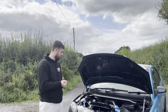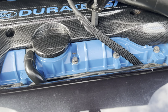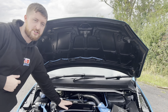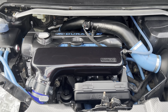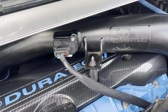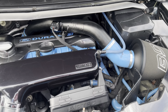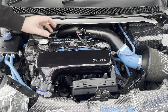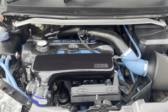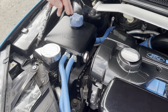We had the engine fully re-spray painted — as you can see the rocker cover is a nice blue. Even down to the whole engine being re-done and re-sprayed. We've got the Airtek plenum on the top here, the RS crossover pipe with the RS MAF sensor, the BDP hoses for the intake and the BDP filter just there. Because of this style of air filter — when you change from the standard air filter — you've got to have this box here to change the ECU, so that's the ECU holder. The coolant reservoir was also changed to the Airtek one to match the nice-looking engine bay.